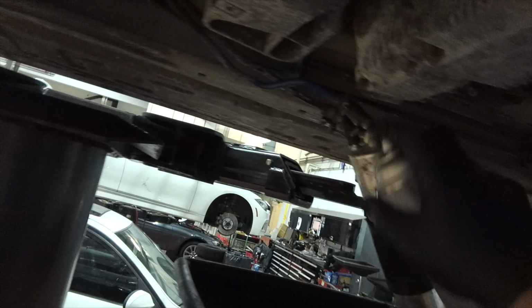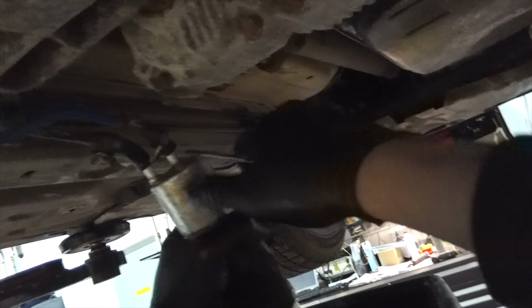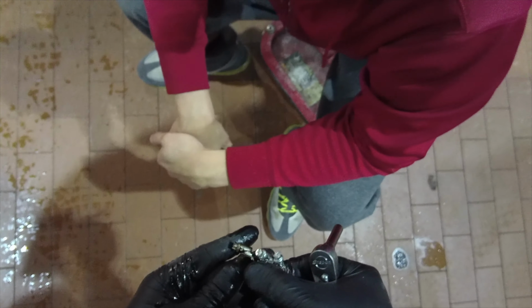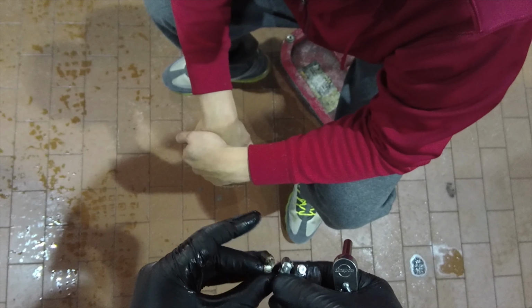Since the hoses adhere to the ports on the fuel filter, try prying enough to spray lubricant inside the hose so it can be removed without damaging the fuel hose. I can barely turn it. In that case, replaced all hose clamps for the fuel filter.